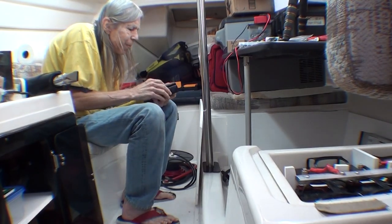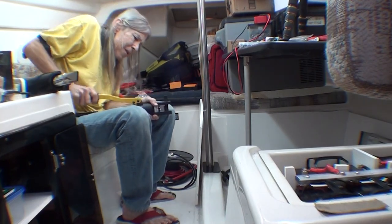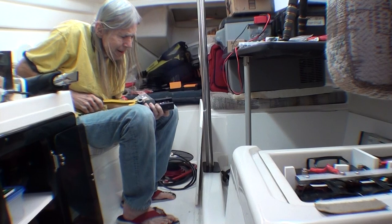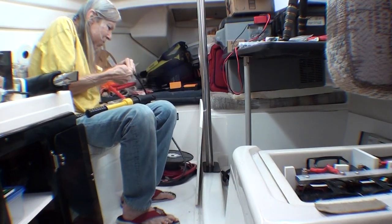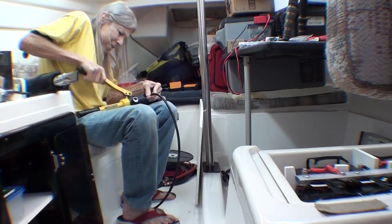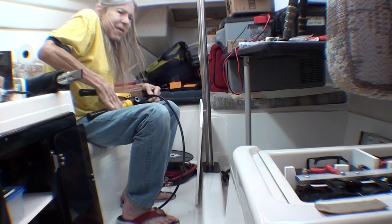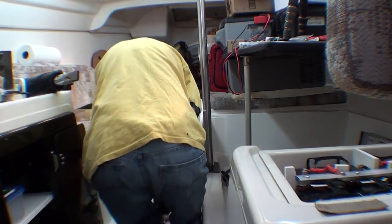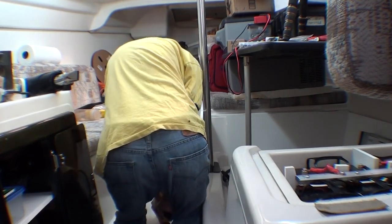While the air conditioner is quiet for a minute, I can hold the jaws shut with my finger while tightening this and making sure I don't pinch my finger. That would be bad. Okay. And now I should be holding the lug in the jaws with just enough force to hold it still while I get the wire in there. And now a few more pumps by hand should crush the lug enough to hold the wire, at least temporarily. And then I can get it against the floor, and a few more pumps, and the hydraulic starts to harden up. Then I can put my weight into it.